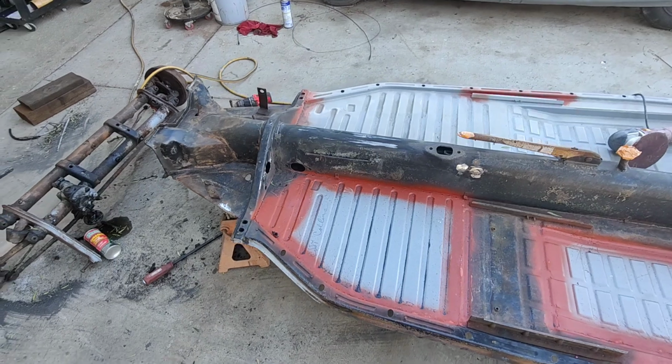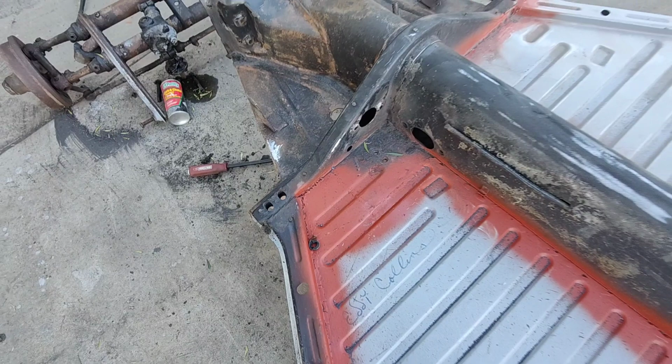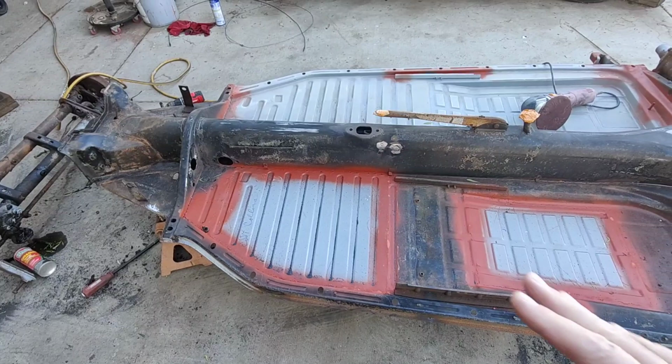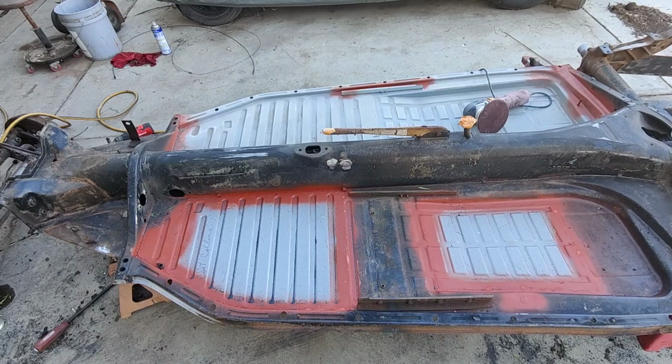All right, let's keep moving forward. I found these things. They were both inside there for the master cylinder, the spacers there. So I just tacked them in place because I don't have to worry about them getting lost. I think that's probably a better method. So I'm going to go ahead and start sanding this thing. Give it a quick sand job, do a little cleaning, get some epoxy primer on it and then paint it with some black.